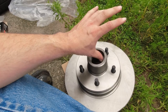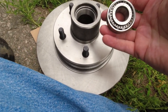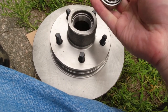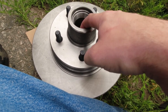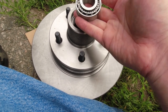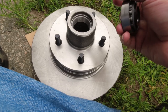Step one is gonna be taking apart these rotors because they already have races pressed into them. But since I bought brand new Timken bearings, I'm not gonna use these whatever-brand races when I have the correct races to match my Timkens. So those are gonna need to get hammered out and the new ones are gonna have to get pressed in. I don't need a press press to do it — I just need something to drive them in, and then continued assembly.